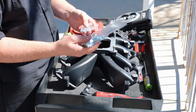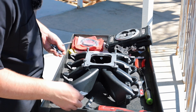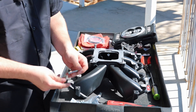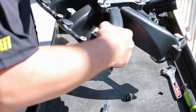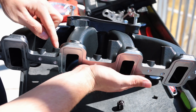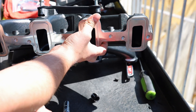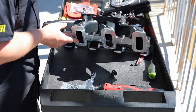We've got some washers for these bolts and we've got our bolts here. An important thing to note — you've got some long ones and some short ones. On this intake in particular, we've got different heights on the mounting: this one here is a little bit lower and this one here is a little bit taller, so that's where those longer bolts go. Little minor things like that are just things to keep an eye out for, and I think they're helpful tips.